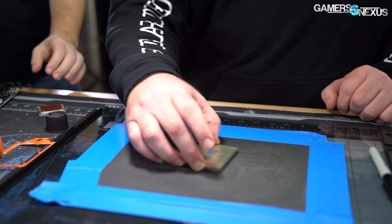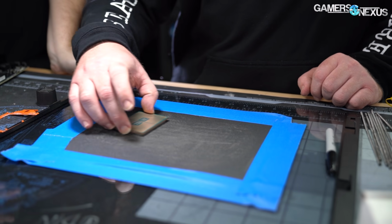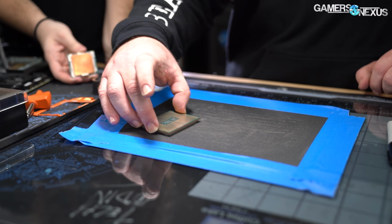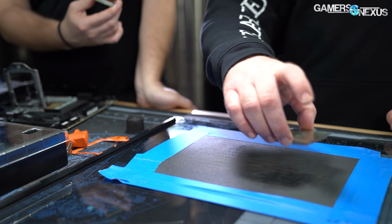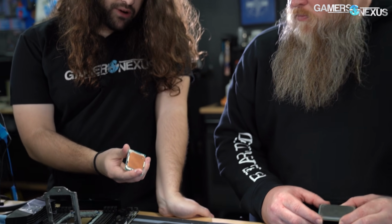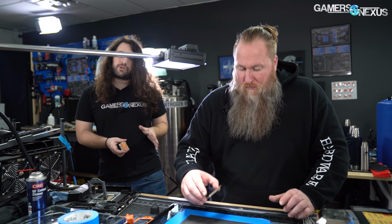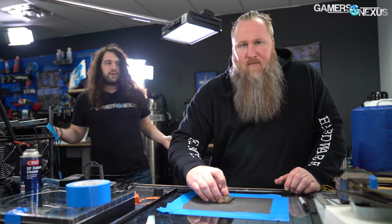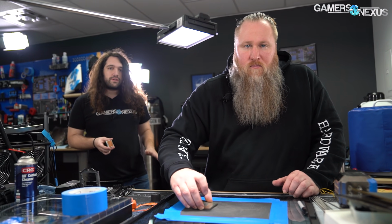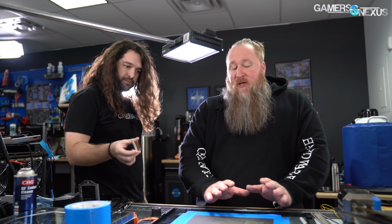Yeah. Every one that I've done, I mean, I haven't tried my 10980 yet. And to really emphasize a point here, before we probably switch over to time lapsing some stuff, this is not about removing just the nickel plating. It's not about copper being strictly better at conduction. Oh, yeah. It's about flattening things out. That's really the goal.